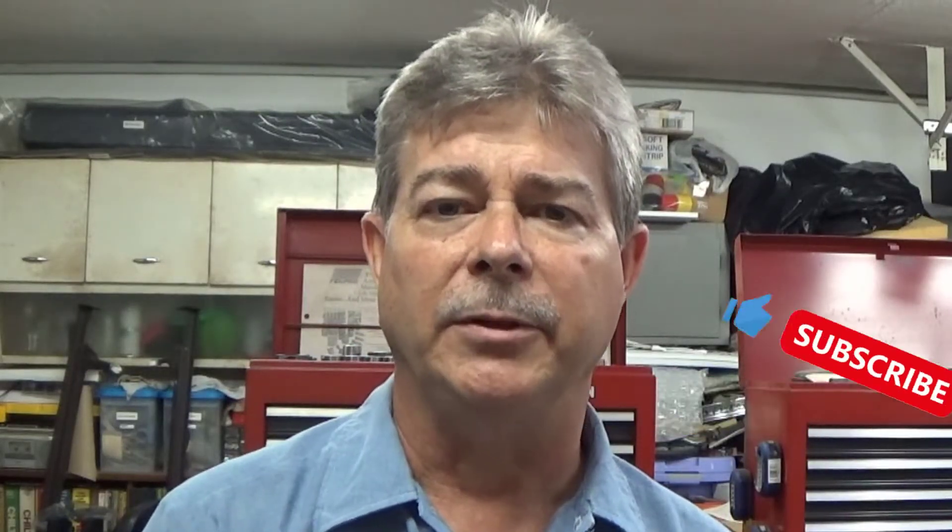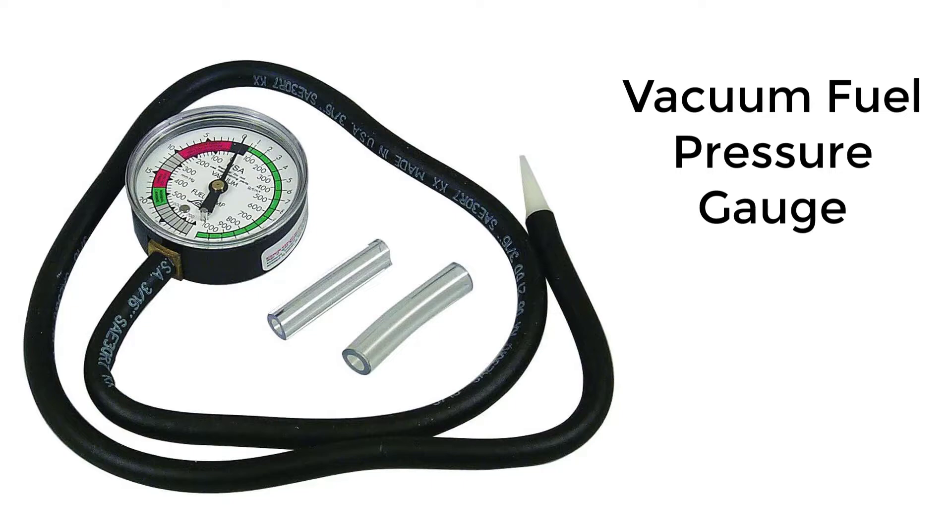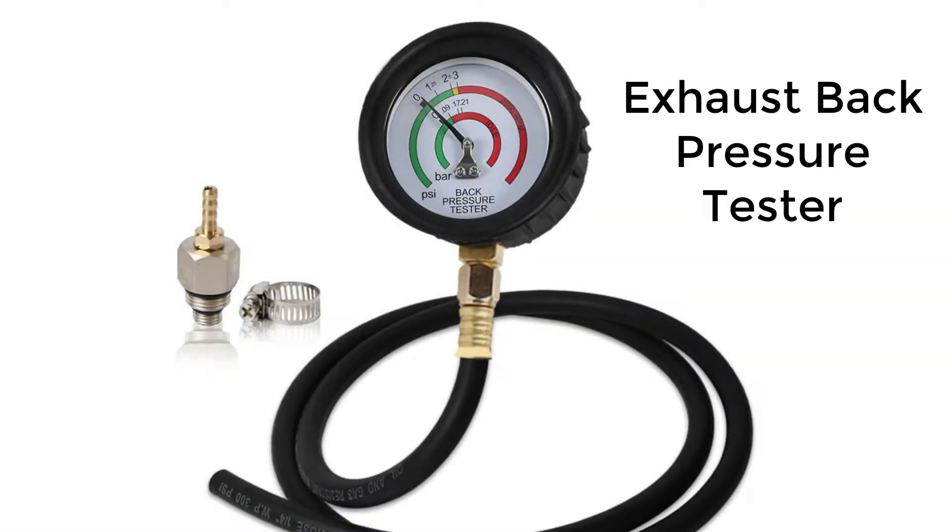There are other videos where you can actually use a vacuum pressure gauge — a gauge that checks pressure on like a mechanical fuel pump on old-style cars, where you don't really produce more than 15 to 20 pounds of fuel pressure. You take those old gauges and hook up little adapters to your O2 sensors on your exhaust system, plug onto them, and you can see what the back pressure is. At idle it shouldn't be more than one pound of pressure; if you rev up to about 2,500 RPM, at most it should be three pounds.